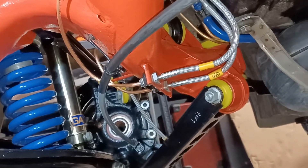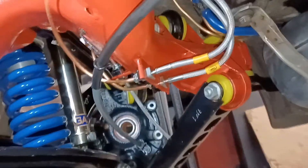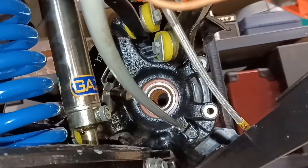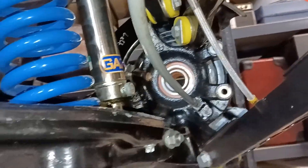Here's what the underside looks like now — the rear suspension. You can see the brake lines are all in. The hard line, which I had to renew, comes across here and then over to here. I just got a couple of new clips for that. The only other thing is obviously the drive shafts have got to go in, and there's no diff at the moment.